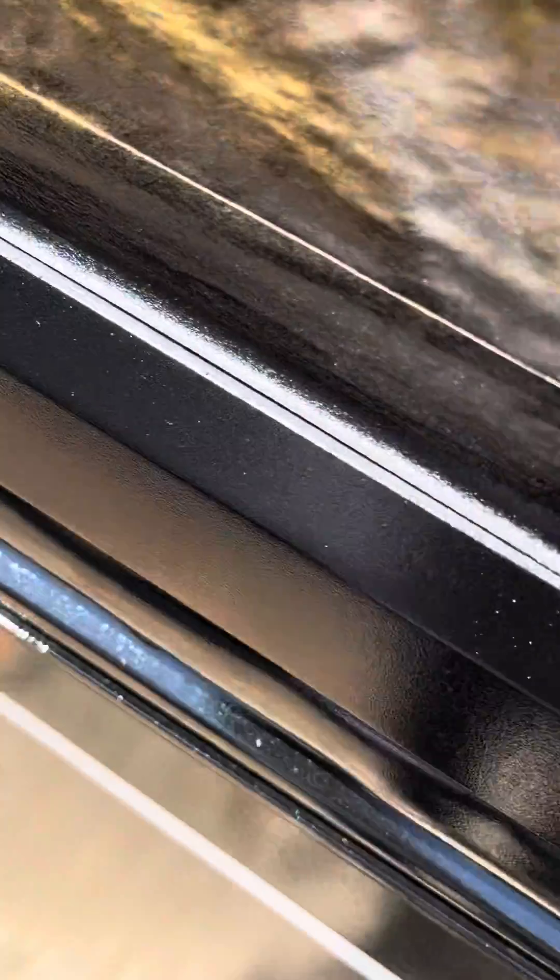I come over with my high solid to get the super high gloss. Now I mix it clear — about 70 to 80% clear and 10% reducer, depending. You've got to check your viscosity. What I do is stick my stick inside the cup when I mix it, pull it out and count one, two, three, four, five. When all the clear runs off the stick at five seconds, I know I've got the right texture to shoot the glamour coat — the top coat, the very top glass coat.